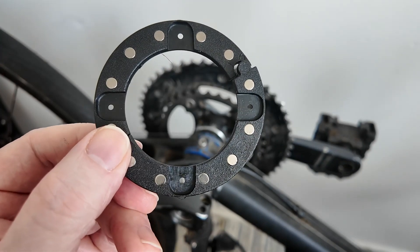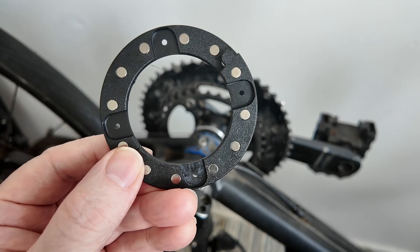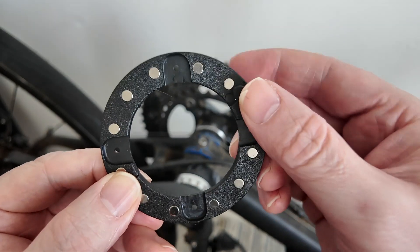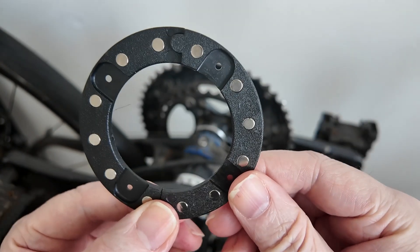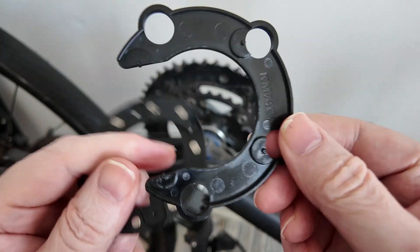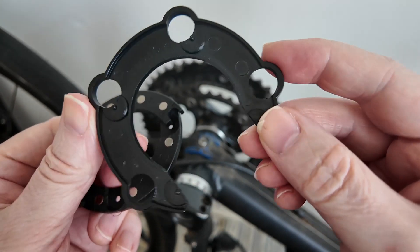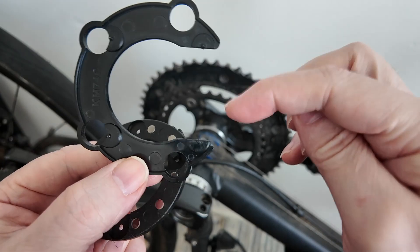The one website where I'm getting my info, ebikekit.com, says 64mm chainrings with four bolts. I don't know whether they're all 64mm chainrings or just four bolts, but that's what it says. I would have thought it would fit any, even five bolts at 64mm. The only other size it can fit is with this adapter — five bolts with 74mm chainrings, but only with five bolts because you need a gap there.